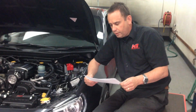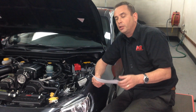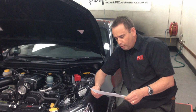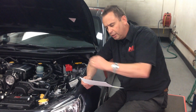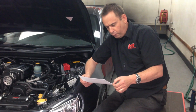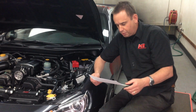With the smaller supercharger, and I'm just looking at it here, a 70 to 75mm pulley is about the peak boost of what that supercharger is designed to run. It runs up around, as we said, 160 to 170 kilowatts, but comparing torque, peak torque comes in at 250 Newton meters around 3,500 RPM, and then just slowly tapers off by about 10 to 20 Newton meters and hovers around 240 Newton meters from 4,500 all the way through to 6,500 RPM. So if we talk about the high RPM range, the smaller supercharger generates 240 Newton meters, whereas the larger supercharger tops out at 310.